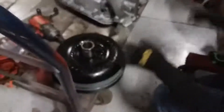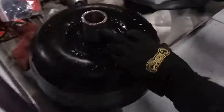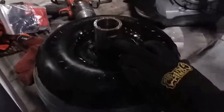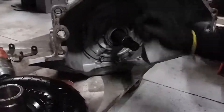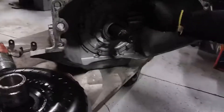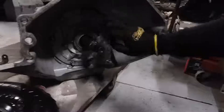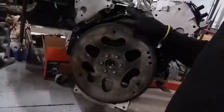If you look right here, this is your pump, and it has a couple sets of gears inside. One of them has flat teeth that line up on this. If it gets installed backwards — and it is flippable, it literally looks no different other than the inside areas — when you flip it, it pushes the teeth forward, so when you go to install your torque converter into this unit, it won't slide all the way in. You literally lose a quarter inch of distance.